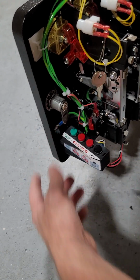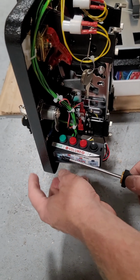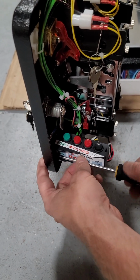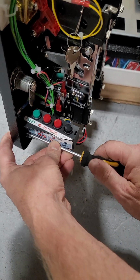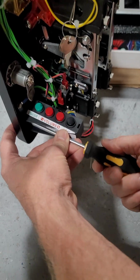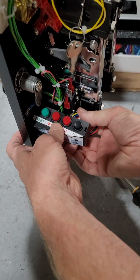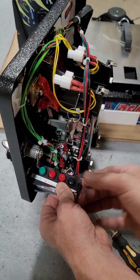And I never tighten this screw. I always start it. Thread the other one. Use a magnetic screwdriver. That'll help you a lot. And have good light. My lighting here is not that great. And then, of course, don't over tighten. Just get them snug.